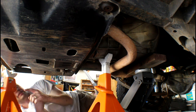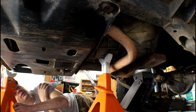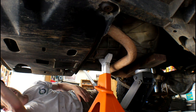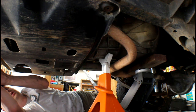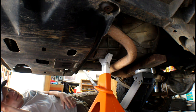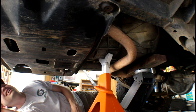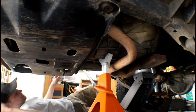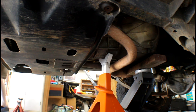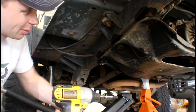Because I don't ever want to hear those sirens come to my house — people get crushed and killed under vehicles every year — I'm putting another jack stand in the back to catch the transfer case as well. Now I've got the transmission and transfer case properly supported and the wheels are chocked. We're good to go.